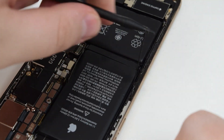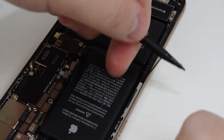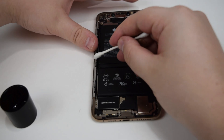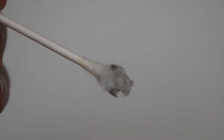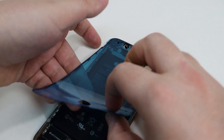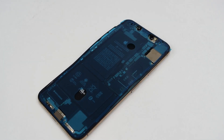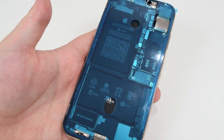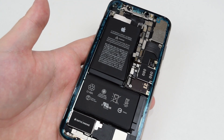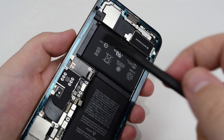Now one of the more satisfying parts of the repair is twirling my little spudger to take off all of the old adhesive on the sides. After that's done, I'm going to be using a Q-tip and some isopropyl alcohol to scrub down the edges of the phone — as you can see, it gets pretty dirty. Now I'm going to be lining the edges with the new adhesive and pressing it down firmly. I'm not usually good at this step, but this time it came out very, very well. I think what I did differently is I applied heat as well as a lot of pressure around the edges, so I knew it was going to be sticky enough and stay there.